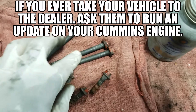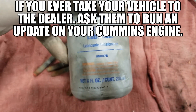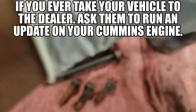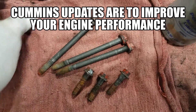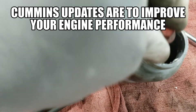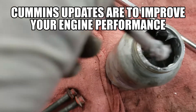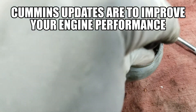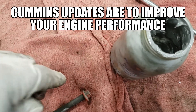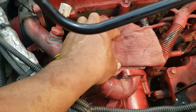These are the six bolts needed to mount the intake back down, and I'm going to use anti-seize on them. This may be a no-no for some, but the reason I'm using it is because I'm planning on periodically taking it off and cleaning it — I'm pretty sure that's going to be a common maintenance issue in the future, something you want to add to your maintenance schedule. I had to cover everything up while waiting on the new EGR valve to arrive.